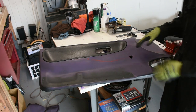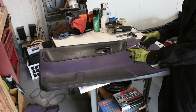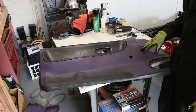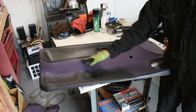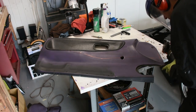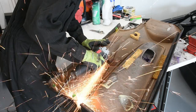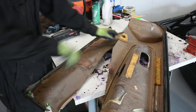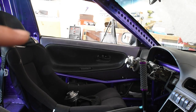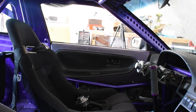I've checked over my red line, made some little corrections, it's looking pretty good. As a safety measure, I'm taking my compass over here, measured to be a half inch larger, and ran it across all of my red lines. So I'm going to initially trim at this lower mark right here and then test fit it just to make sure I'm not taking off too much material at once. Here's a test fit — I've compared it with the other side, it still needs to go up exactly to where the red line is, so I'll take it out and cut it again.